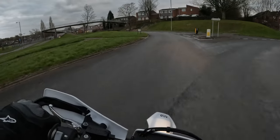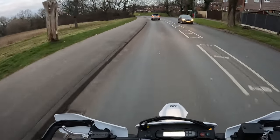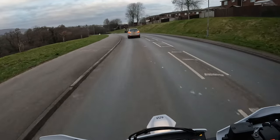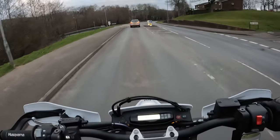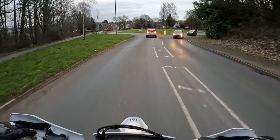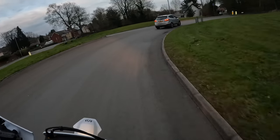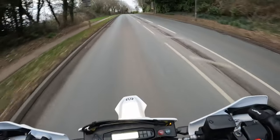I love the way this bike just lets you chuck it around. One other thing — my brother Big Pouse bought one of these as well and got very similar parts with his £500 voucher. But one thing he did when fitting the skid plate was adjust his rear brake lever, and I can see why. If I put my foot over it I'm pushing it on, and I notice it dragging on the back brake — it's in a completely different position to the DRZ. It's slightly lower on that. It's basically too high, so I'm going to have to adjust it, but apparently you have to get the skid plate off to do it — which I just fitted, so it'll probably have to come back off.